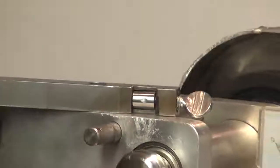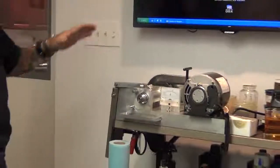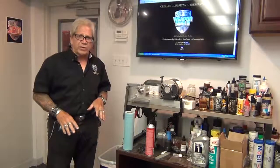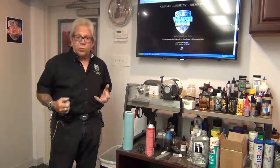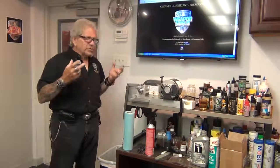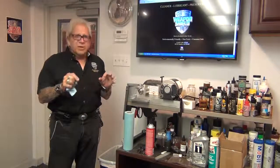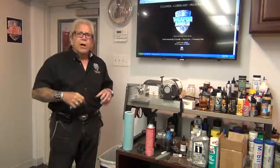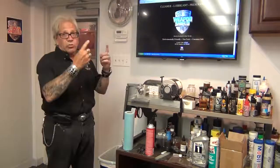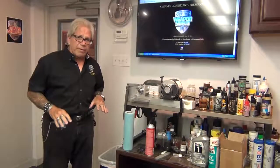Like I said, nothing is forever. Weapon Shield will burn out. I only went to about 10 to 15 pounds, because if I were to take it the whole way down to 25, then of course it certainly would. The lifetime of the advanced boundary film is always going to be stipulated by the amount of pressure under a certain amount of time. If you're putting it under enormous pressure like that and the heat is going through the ceiling, it's not long before you'll destroy that boundary film.